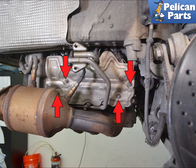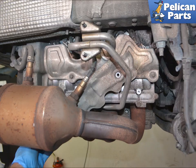There are two heat shields between the heads and the mufflers that you need to remove. The heat shields are held in place by four E10 Torx screws, indicated by red arrows. Remove the screws and slide the heat shields back and down and out from between the head and the muffler bracket. It will be a tight fit but there is no need to bend the shields.